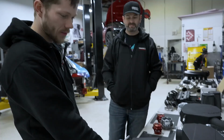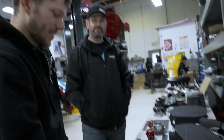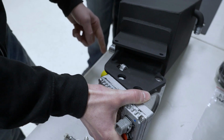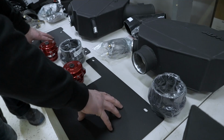Water tank for the intercoolers. So the frame rail actually just sits right here. So we send some bolts through here, and it actually kind of clamps it. We have some rubber foam to isolate the noise. I don't want to give up any room in the front. And then what's kind of cool is we mount this guy. So that'll mount there, and then this just pulls water right from that tank. All in the wheel well area. Intercooler stuff. Air boxes use these mounting points, so we made these plates. Intercoolers mount to those plates, and blow-off valves, couplers, and everything there.